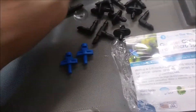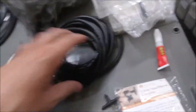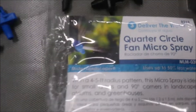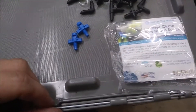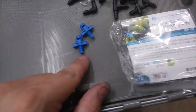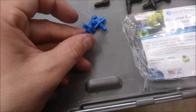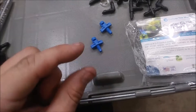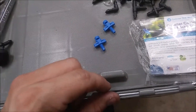I just bought them for the T's. I also picked up about 30 feet of hose. Total spent about 10 bucks. So instead of using these factory ones that don't really spray the intercooler, I actually tested the new ones off the car and they work way better. They have a nice fan spray to it, so the water droplets are smaller and it's going to cover more of the intercooler.